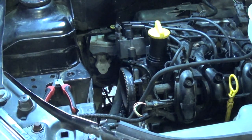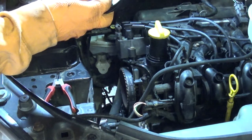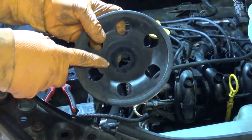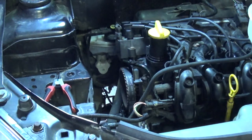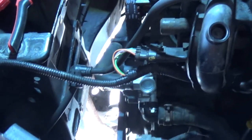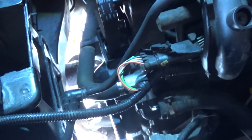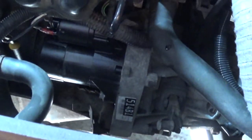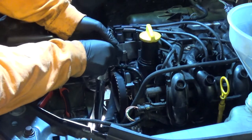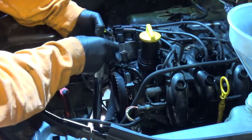Interestingly, the clip on the other hose going to the water pump was the nice spring-loaded type that keeps its tension at any temperature. I'm going to go ahead now and reinstall the crankshaft pulley using the new bolt that came with the kit. Observe there is a little keyway, so it only fits in one orientation. There is a torque wrench setting for this, and then it must be further tightened by a number of degrees. The hoses are done up and you can see there's a timing pin in place — now I'll go ahead and torque the pulley in.